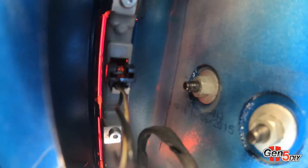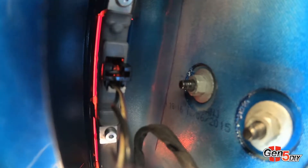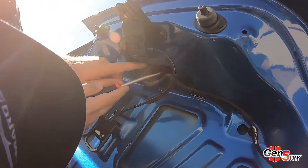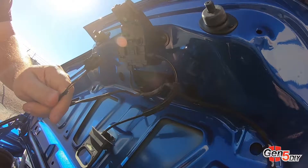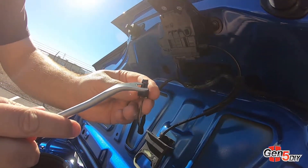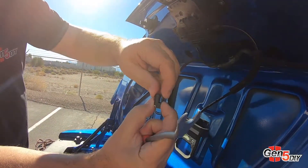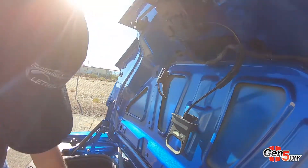We've got to get up into this little hole right in here, and you can actually see the plug right there — that little black plug with the red wires going into it. There's basically just a little push clip. If you have a flathead screwdriver or a tool, you can push in closest to the light and it comes right out. What I did is I pushed as high up as I could right there, because if you just grab it by the tip you're not going to have enough leverage to push that in. Once that's out, get your harness.